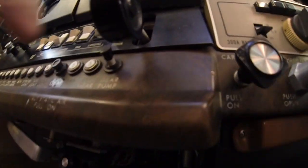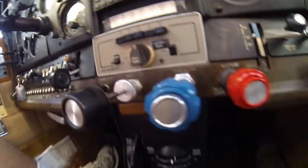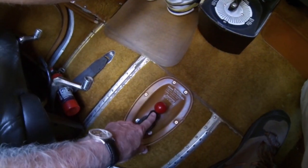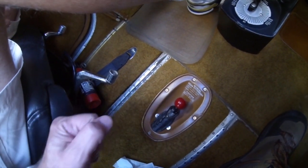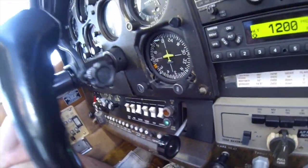That's how it's done. So you pull the pump handle, put the gear handle down, and pull this out straight. Then you pump it — it took me about 30 to 40 times. You get almost no tension for the first 20 pumps, then from 20 to 30 it starts going, and from 30 to 40 it gets really, really strong — and that's when the gear light came on.